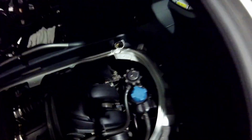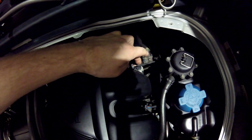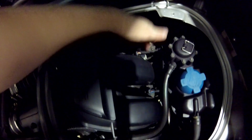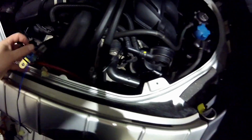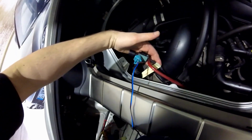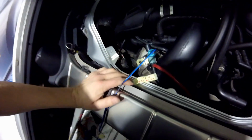So twin cylinder 1 and 2, here is a valve, and you're going to pick up the vacuum from the bottom of this one. So what I did, I loosened the contact here and picked up the valve and removed the bottom line and put in a T connection, and there's this hose here, and it goes to this valve here. And then you have a vacuum hose that goes to the valves on the exhaust system, and this is the control cable.